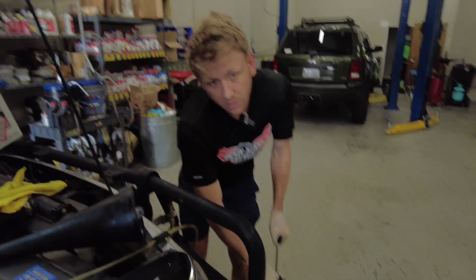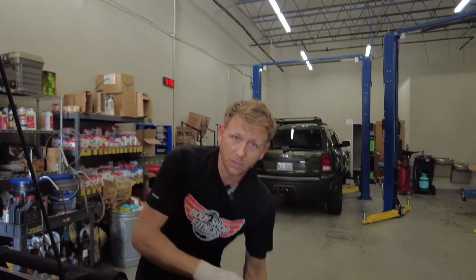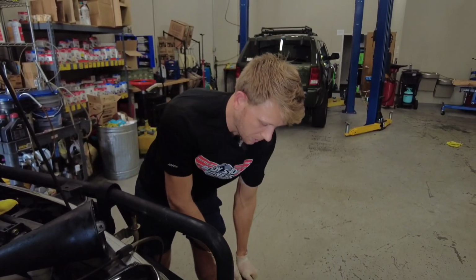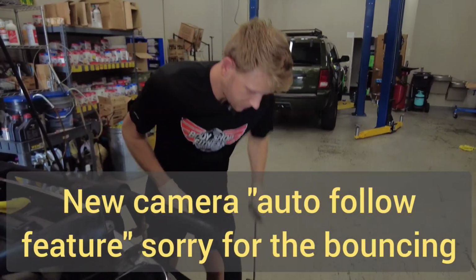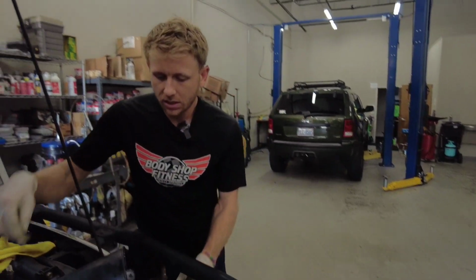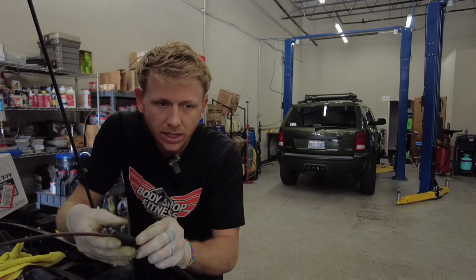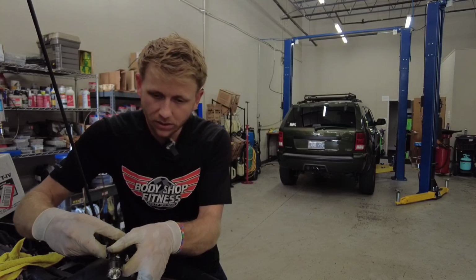Make sure your pump is set on extract, because most of them are also fluid fillers as well. They can pressurize. So I'm just going to pump it to get some vacuum in the big reservoir here. And what's coming out is pretty red, but it is dark. You can see a little tint of red there, and it's still working now.